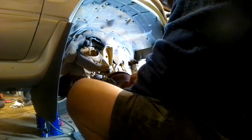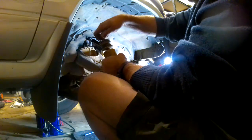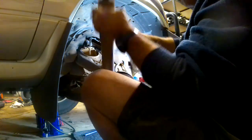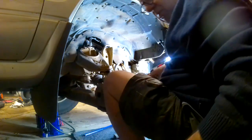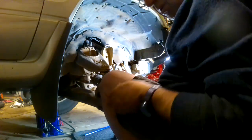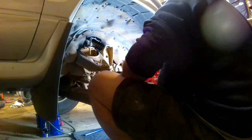Whoever assembled these did them incorrectly, because they put the big nut on the top and the little nut on the bottom, but the little nut is the lock nut. The big nut is the nut that does the tightening. So they put them all the wrong way around. KYN, KVN. I reckon they're a Chinese copy. XLG. Sounds a bit Asian-y, doesn't it?